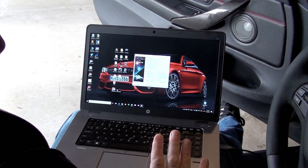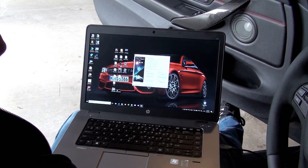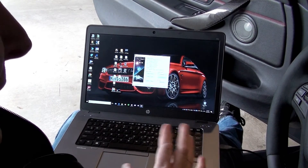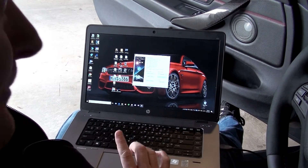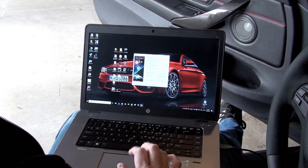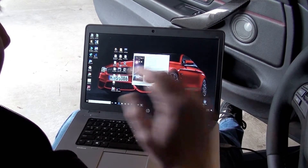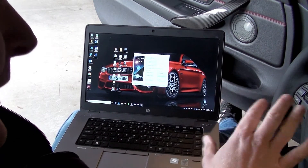That's the point where my car freaked out — I had all kinds of error messages on both displays, which is perfectly normal because your car is basically having brain surgery while it goes through this process. Don't be surprised if you see all kinds of things going by; they'll straighten out and be just fine. The progress bar can be a little slow — it hung at about halfway through for me for a while, and then eventually finished. At the very end there's a step where you turn your ignition off, still with the software running. Tell it your ignition is off, turn it back on, it'll read it, and you should be good to go.